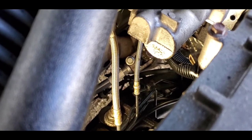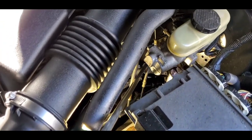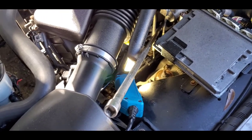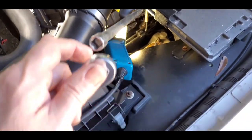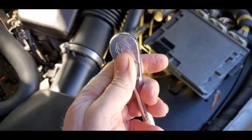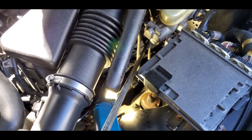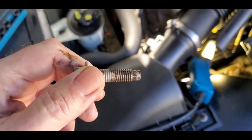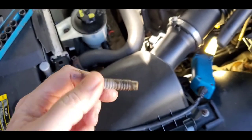Looks bigger than a 10mm - I think that's probably a 12mm, it's probably metric, but I'll find it. There we go, my extension is on it. I decided to use a short one. It wound up being a 13mm - I thought it was a 12mm, it didn't look like a 13mm to me. You could use a half inch if it's a 13mm - it's really really close. I'm going to have to have both hands here. The bolt's out. I do not see any thread locker on there, so I don't think anybody used thread locker when they put that on, but it did take a little bit of force to crack it going.